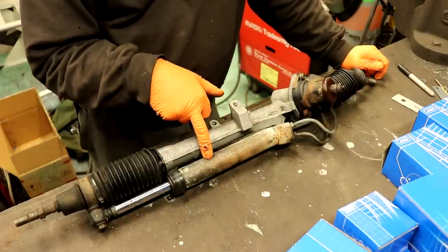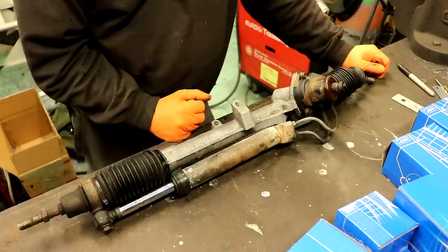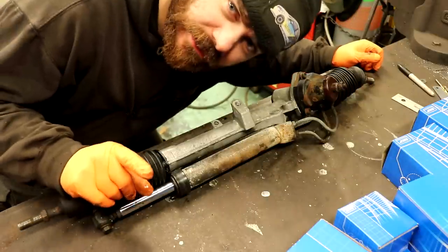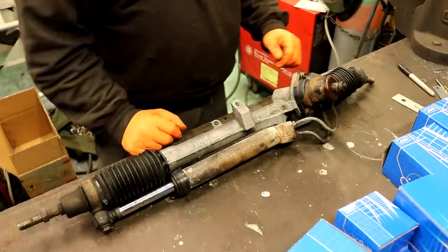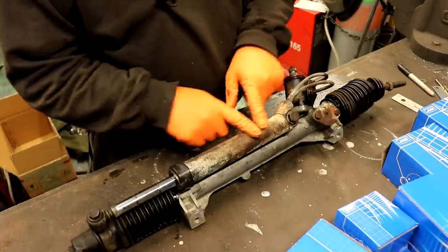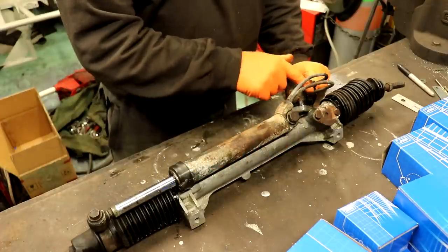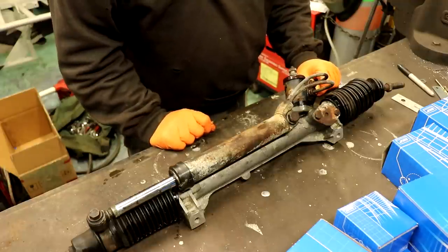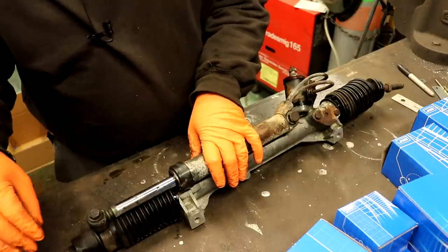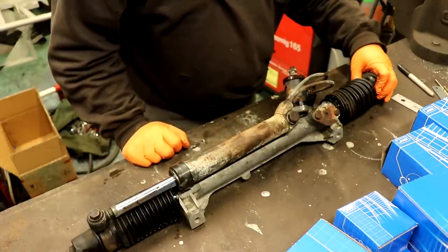If you want to see crazy Citroen suspension, you need to see an SM's — I've got an SM, did I mention that? Job now is to remove the ram, which is just bolted onto the outside. This is an LHM return pipe. I'll take this ram off, which means doing either those two or these two unions — I'll probably go with those two. I'm going to take off the rack ends as well, and that makes it even easier to change the gator because they need changing — they're all split. I don't know what brand this is; it doesn't even look that old, but it is.